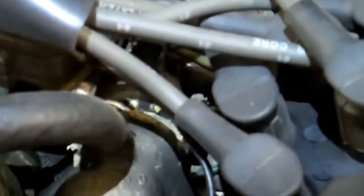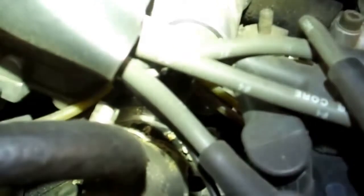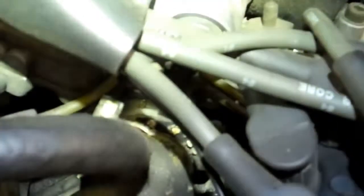The water pump bypass hose is starting to leak a little bit of coolant. Right there is where the bypass hose is located, and it's been leaving some residual coolant spots — a sign that this hose is getting old and leaking from the thermostat housing. We're going to recommend that you change the water pump bypass hose. If you haven't had to add coolant it's probably because it's been cool, but in summertime when the cooling system gets hotter and pressure builds up, you'll see more coolant coming out of this hose.